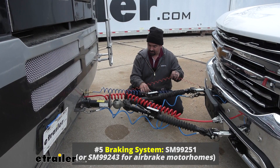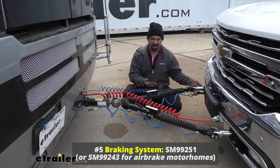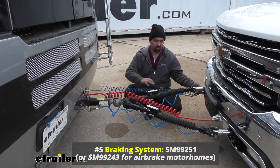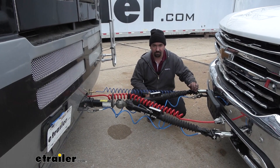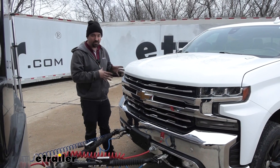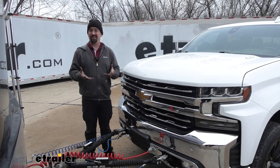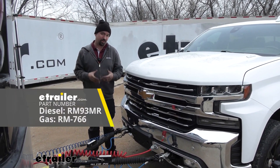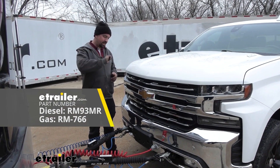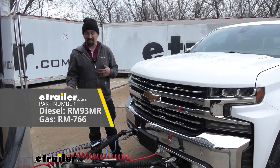This is our breakaway switch, which is part of any braking system. In case of a catastrophic disconnect where everything was to fail, it'll pull this cable bringing the vehicle to a slow or stop. Now something that's specific to the 1500 and a few other newer vehicles is the fact that it has electric assist brakes, and what you're going to want to do with that is add a battery disconnect. That way you can disconnect the battery and it's going to keep the braking system working fine as you're flat towing the vehicle.